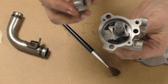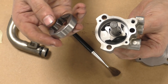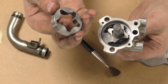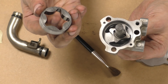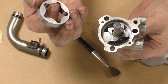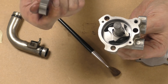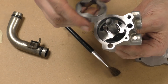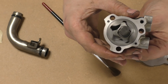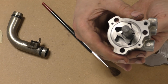Then you have this outer rotor. Now all this has been wire eroded — not EDM'd, wire eroded. So this has not been cut by a milling machine or anything like that — it's literally been cut by an XY wire eroder. They just nibble away at whatever profile they need. The outside is surface ground and these are all hardened tool steel. Then basically you slip this outer rotor in like so — they're both allowed to spin.